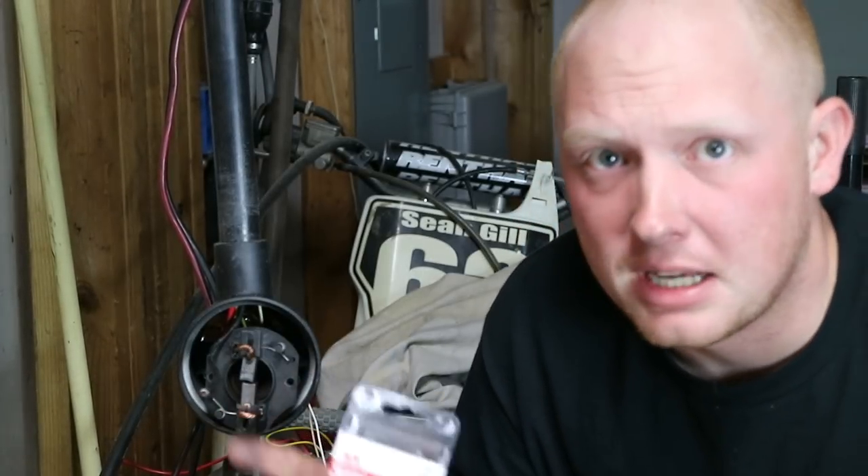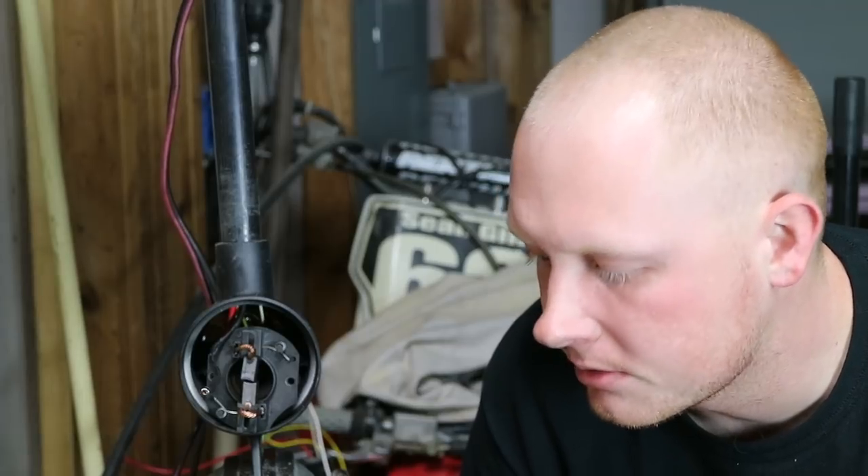So a new problem has arisen. I put together a trolling motor, hooked it up to a battery, tried to turn on the switch, and nothing happened. I think there's probably just a loose wire somewhere or the brushes aren't sitting on the commutator correctly. I may have damaged the armature while I had it out, so we're going to take it apart. We found the culprit — it was one of those cheap connectors I was using before that I bought from Amazon. Went down to Ace Hardware and bought a bunch of female insulated terminal connectors — a 50 count, like $13 or $14. Not too bad.